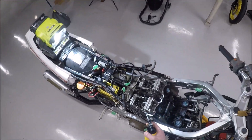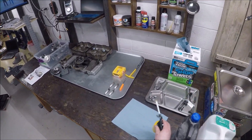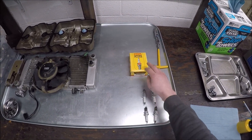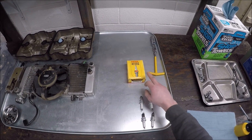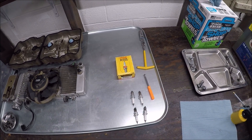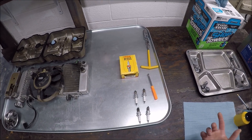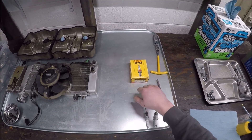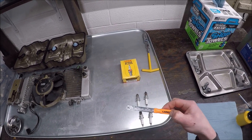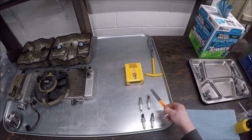I've been going around with my new little squirt gun to make sure there's oil in everything — kind of fun, never had one of those before. The spark plugs I pulled out were DPR8EA-9s and the ones I'm going to be putting in are DPR9EA-9s. These are for standard climate; the ones that were in it were for colder climate. I gapped these — the tolerance says 0.03 to 0.04 — and I set them all to 0.034.